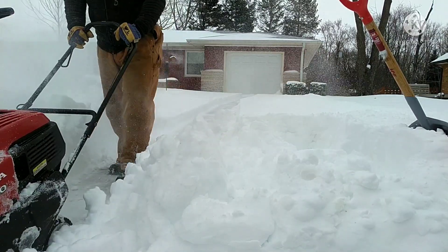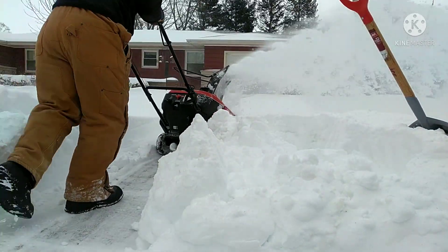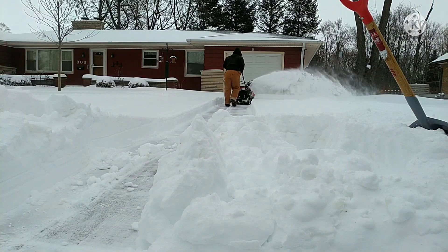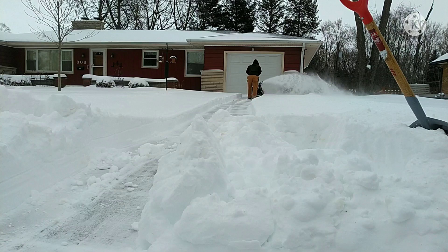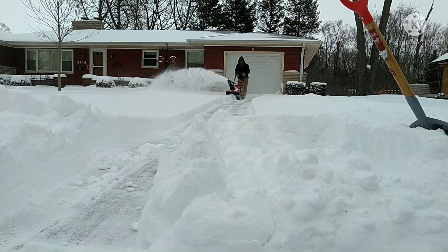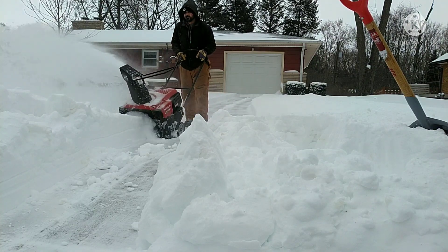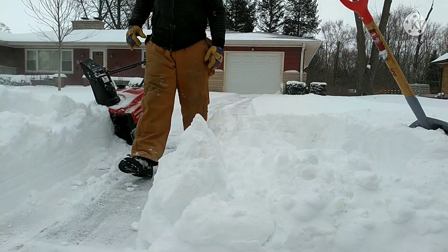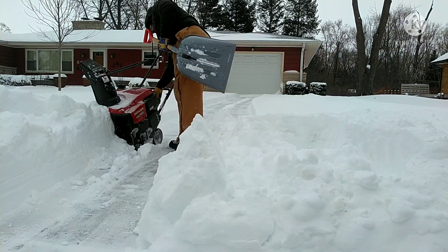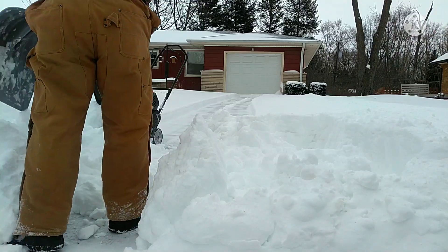It was missing a little bit again. I looked at that carburetor in the last video and cleaned it a little bit, but it did not seem to help too much. So I'm thinking I'll maybe just order a new carb. I just have to play with the choke a little bit and it seems like it still goes through fine. It's just when I'm not running snow through it and it's kind of idling, a lot of times it's running rough. But it didn't seem to have any problem with this at all. I take the shovel and bust the snow down just a little bit more, and right there I'm playing with the throttle and the choke and messing with it.